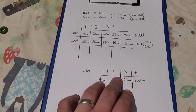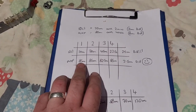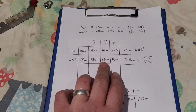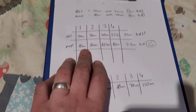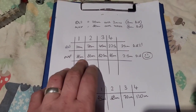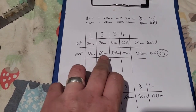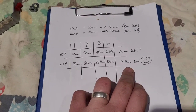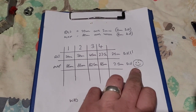So I've readjusted it all and this is where we're at. At max fueling, we've got a little bit more than book figures, which is ideal because the KJets have got a habit of running lean at high RPM. After 27 adjustments and testing, I've got 85 millilitres, 85, 82.5 and 85. That gives us a 2.5 millilitre difference, and we're allowed 8 millilitres. So full whack - happy, smiley face.